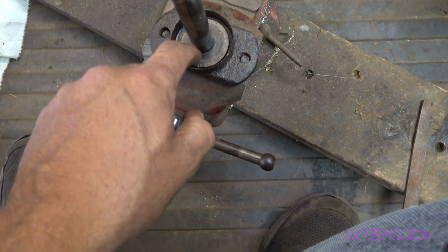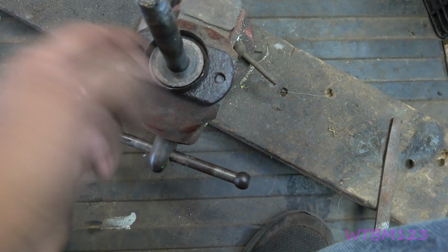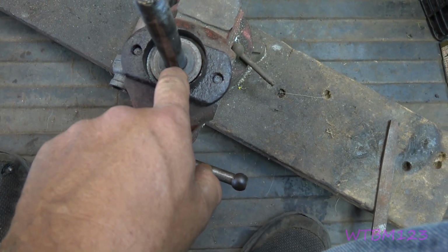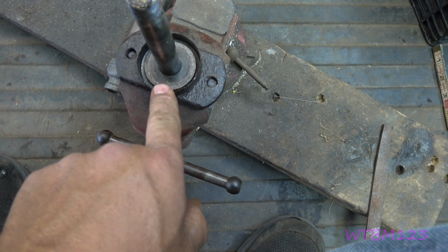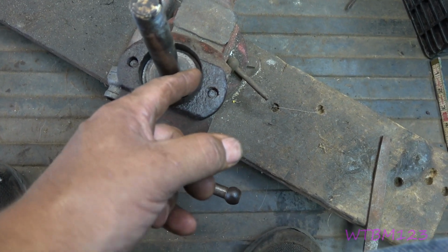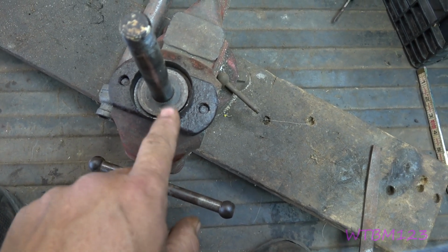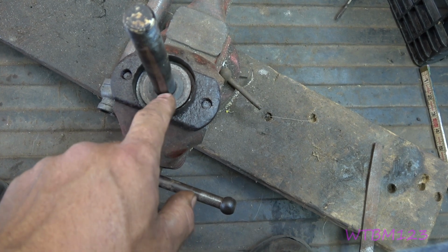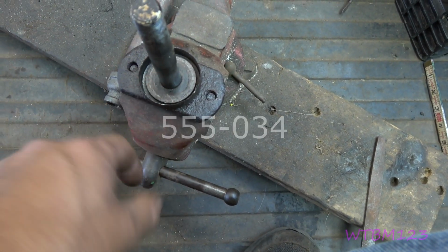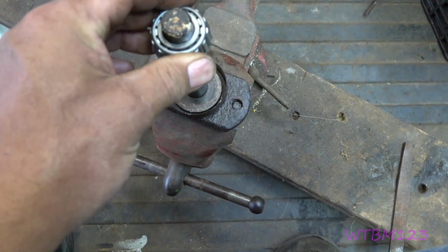Now see, this is the one that's got the sealing washer that's metal. Someone's already put it in there, so it's going to stay there. I don't know where you can get the sealing washers or the metal cups. Jeremy on the Sears Suburban Tractor Facebook thing said about a Dorman soft plug that you can get and drill a hole in the center, which does look a lot like it, and I'll put the part number in the description or on the screen or wherever I can.